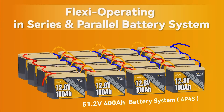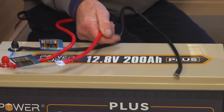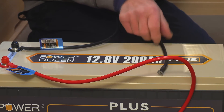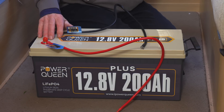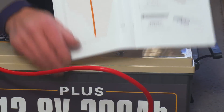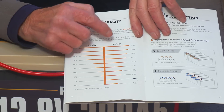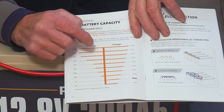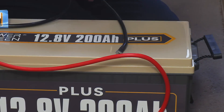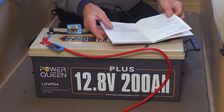At the end you've just got these last two connections to hook up to whatever you're connecting to — in this case a 12 volt supply on the camper van, so I'm only ever going to use this one. The state of charge on the battery: if it's got 10.8 volts it's 1% charged; if it's 10% charged it goes up to 12.8 volts, and incrementally it goes up from there — the instructions show you exactly. When you've got 100% capacity you've got 13.5 volts. When you're charging you should charge at 14.2 volts — not 12 volts — though the controller will give you a nominal 12 volts.